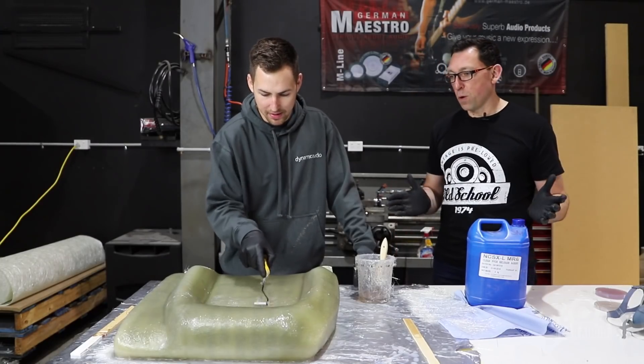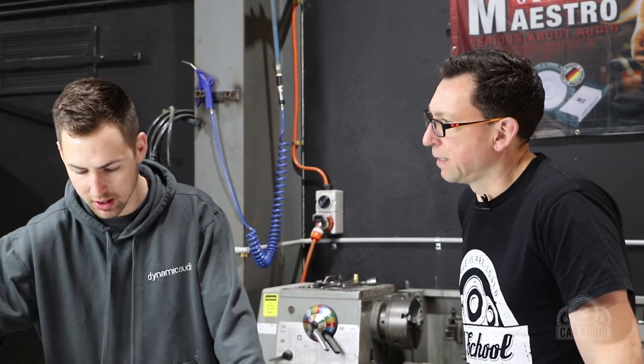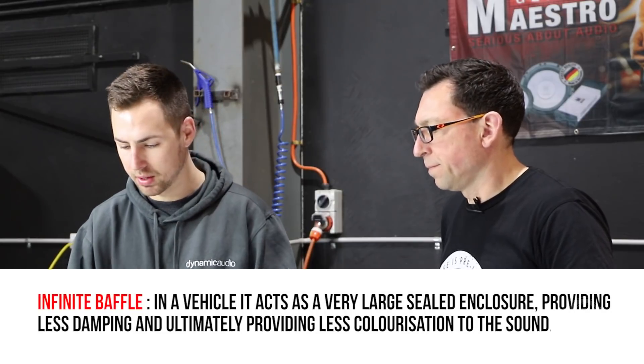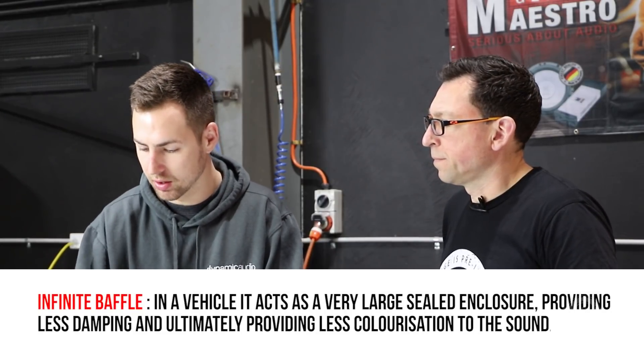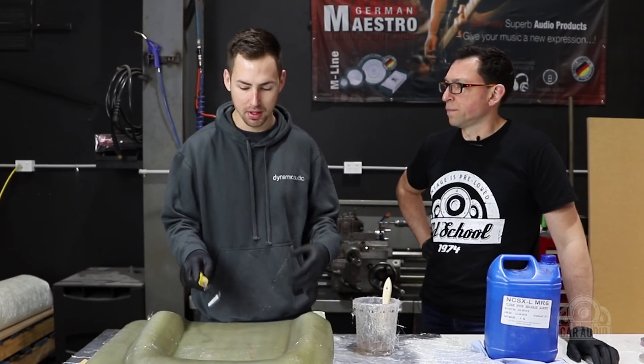Tell us what we're doing with this back seat. The idea behind this is essentially I've redesigned the entire car — as you do when you can't decide what you want. I want to go infinite baffle across the rear and do a complete seat delete. I was already looking at running a roll cage anyway, so I figured the seats are impractical to begin with. Originally I was going to build a mould in MDF so it looked like a finished baffle for an IB setup, then take a mould of that, cast it out of glass or carbon, keeping it lightweight.